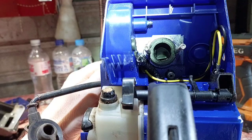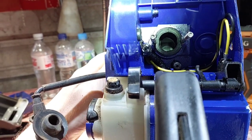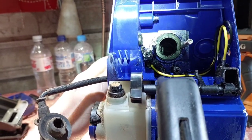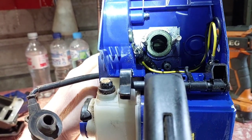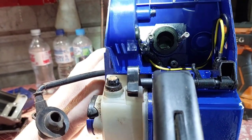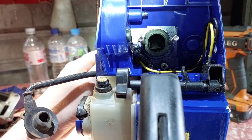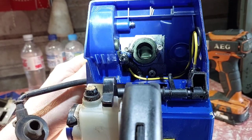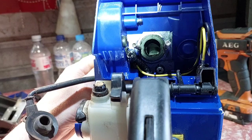The piston opened here at 69 degrees — that's when the suction starts. As the piston goes up, it starts sucking air and fuel in. Then that piston starts coming back down and becomes a plunger, pumping fuel and air to the sump of the cylinder. Which makes me start thinking: why do we carve out the arse end of the intake? Because the more we carve that down, the less chance to put volume in the base of the sump, and less time it has to compress. Or are we doing it wrong?